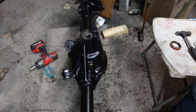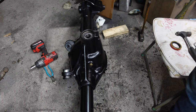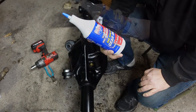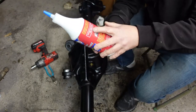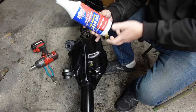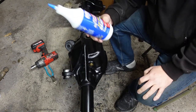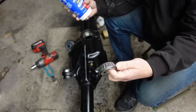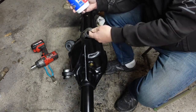There was a little bit of a delay getting out in the garage — the power was out and it was a little too cold to work last night. I did a little bit of research and was recommended the Lucas Oil 80W-90 gear oil, excellent for use in limited slip differentials. Obviously I'm not going to fill it up right now, but you want to lube up your bearings before you assemble everything, so I'm going to get this all cleaned up, get these lubed up, and start assembling.